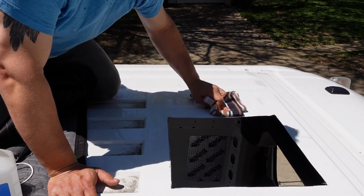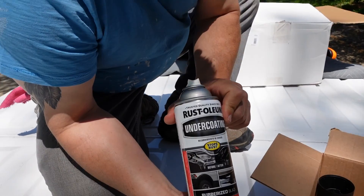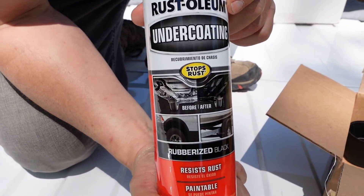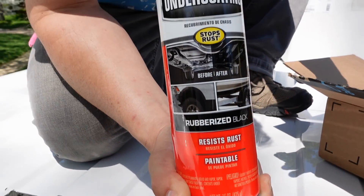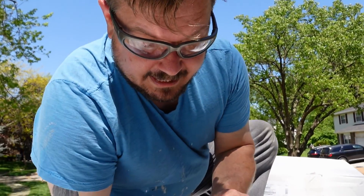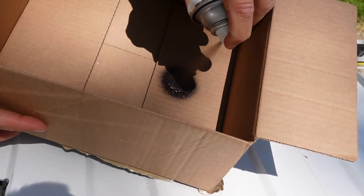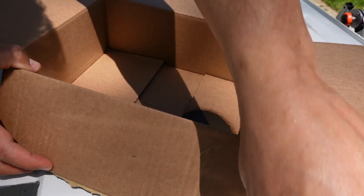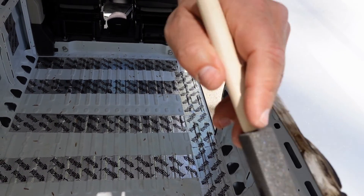Make sure you have a really good clean surface for when you put your butyl tape and flex seal down. Next, we want to get a little paint on this — this is some undercoating paint, an automobile paint by Rust-Oleum. I'm not sponsored by anybody, but I do think Rust-Oleum makes a quality product. What I like to do is just spray it in there — you've got maybe about a minute before this stuff starts to set up. Just hit the corners and that bare metal to protect the paint and keep it from rusting.